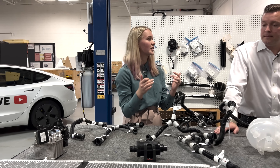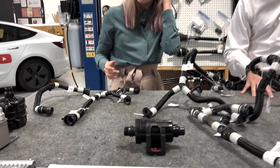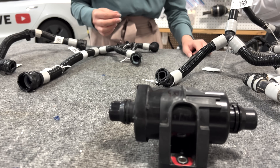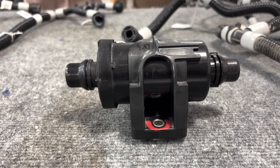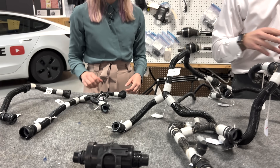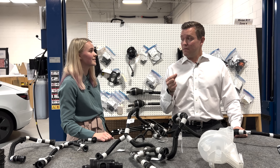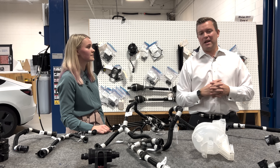This is a coolant filter — you'd see it on the front fascia just behind the AC compressor. Our team has concluded that there may have been some particulate left over from coolant plating during manufacturing. To ensure it doesn't damage other parts of the vehicle, there's an inline coolant filter in the middle of the system as a failsafe. They may not have time to test every part of the coolant system for particulate ahead of time. Our team has never seen an inline filter before across all the PHEV, HEV, and BEV systems we've examined. Part of the reasoning is that some spaces in the battery for coolant flow are so small they don't want them getting clogged — it's an expensive piece that may be eliminated in the future.